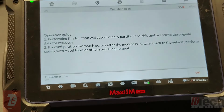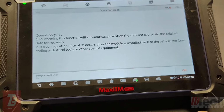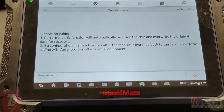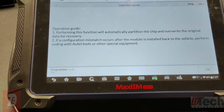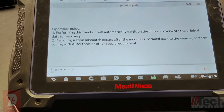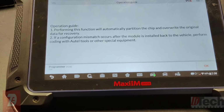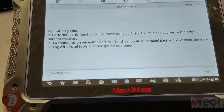The issue is that when it does the repair, it leaves it not proper to the actual vehicle VIN that it came out of. So you'll install it, and you'll get operation back as far as lights and windows, but it won't be 100% correct because it's not coded to that car, or the EEPROM is not for that specific car. So you get improper window operation. The biggest sign: you hit your window switch for the driver's door and the passenger window will go down, and vice versa. It works, it just acts funky. You rectify it by programming.